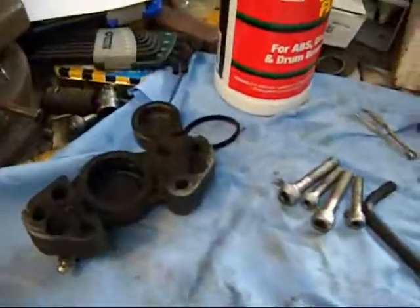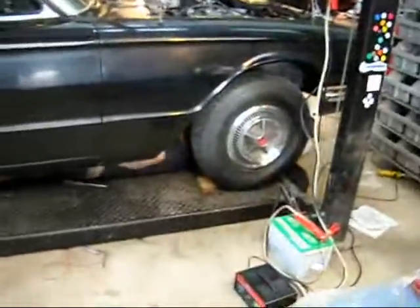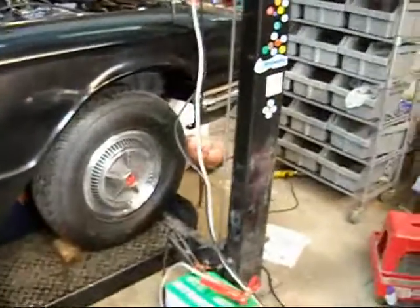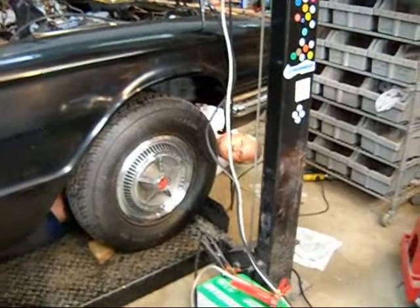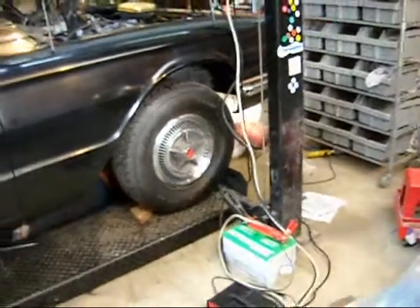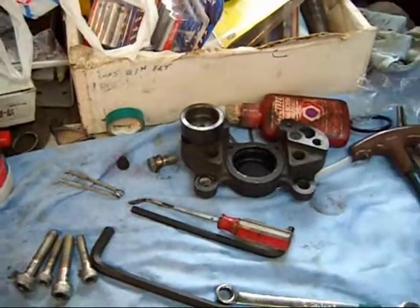Putting that together, and I'll end up putting the return line in the fuel tank. Assembling it with a little Loctite on those bolts and the seals are in there. I think I only got 297 hours on the original calipers, but these rebuilt ones should be good for a long time. Got the brakes bled and everything. So I'm getting real close now.